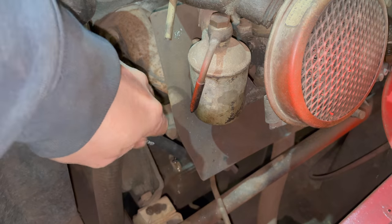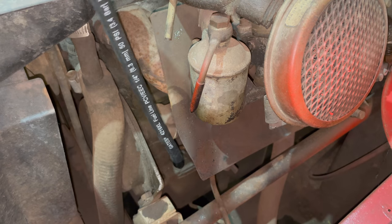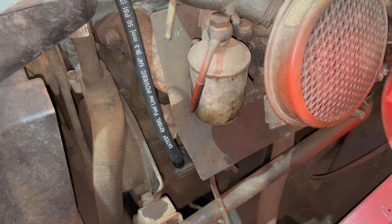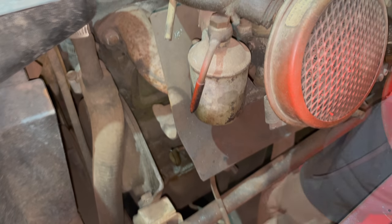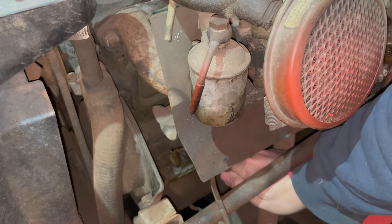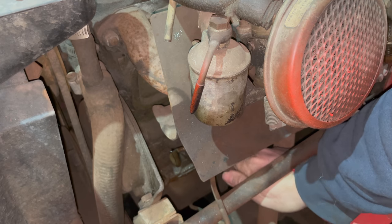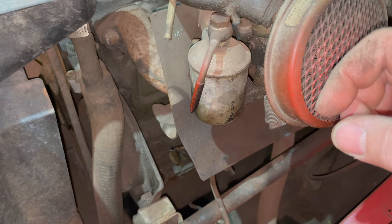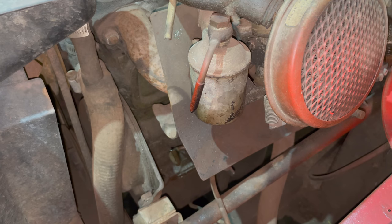If the fuel pump works, I'll be able to have this car run on its own. So I'm hooking up my fuel bottle to dump fuel through the pump to get it primed up, then I'll crank the engine over a couple of times and see if it pumps the fuel back out. It did not appear to be working. It does have a manual lever on it, and pumping that it looks like the pump is not working - feels like it's stuck. Unfortunately the fuel pump is not going to work, but I can hook up my IV back to supplying the carbs with fuel and use it that way to drive it out of here.